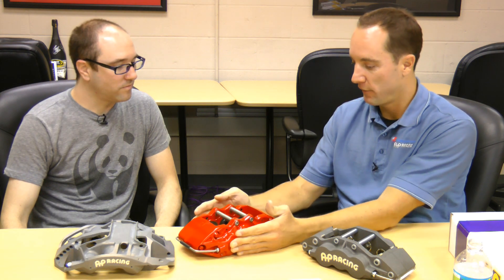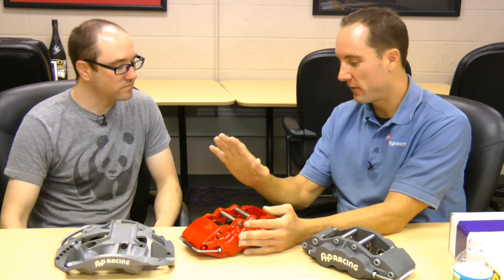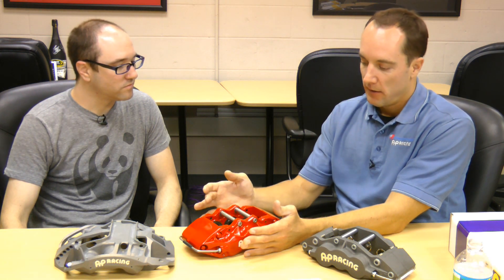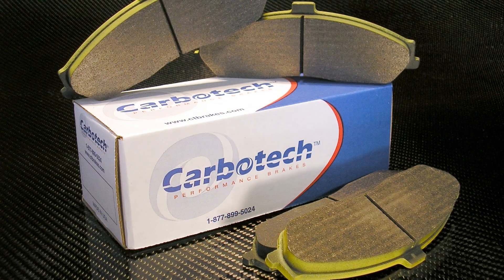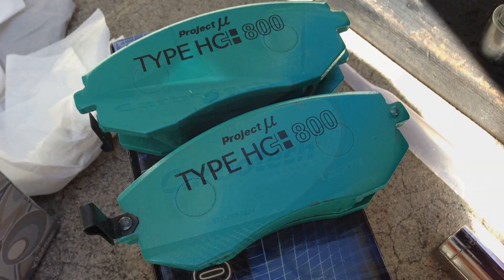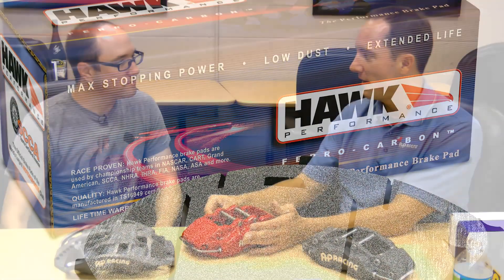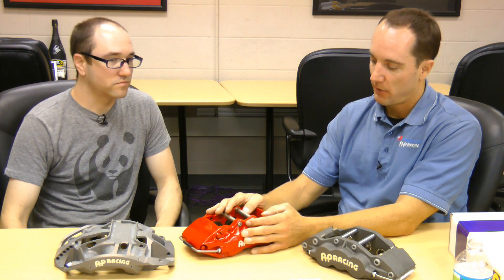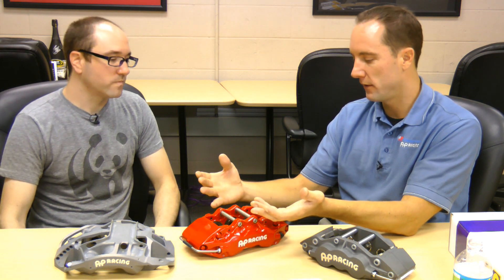An opposed fixed caliper is going to feel much better — the pedal is just going to feel a lot firmer and nicer. Also, this caliper may have 50 pad options for it, whereas your factory caliper, particularly on a new car like when the FT86 came out, there aren't that many pad options in the first year because manufacturers haven't had a chance to make them yet. So a big brake kit will give you a lot of options — all kinds of different street or track friction available.